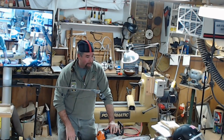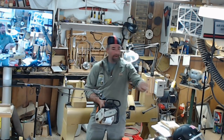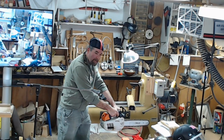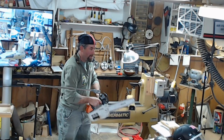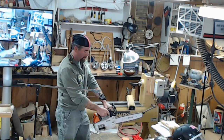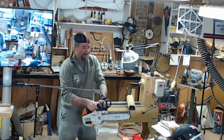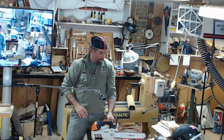And a good firm grip. Hold that saw. Another one is when you're cutting, you want your left arm almost in a locked out straight position, because that way you can keep it locked out when it jumps. It can come up or it's going to go down. You don't want it to have this bend. You don't want to be here and have it go wherever. There's no control when your arms are bent. So you want that one out there good, straight, locked. It doesn't have to be completely straight, but you want a good firm grip and a good brace on your left arm.